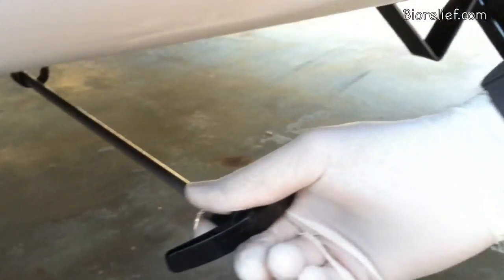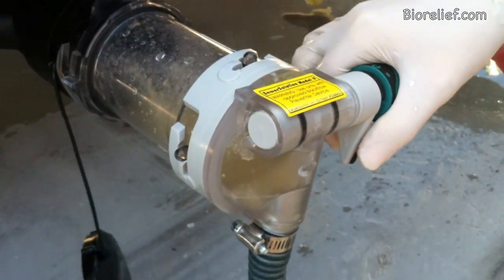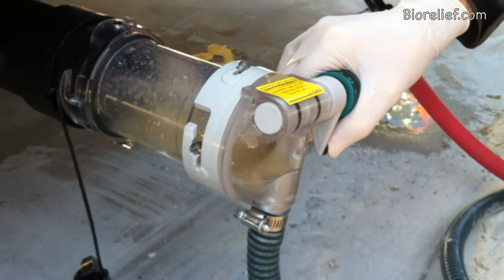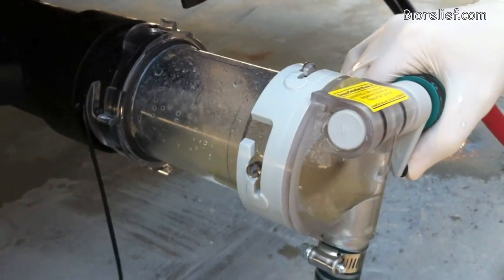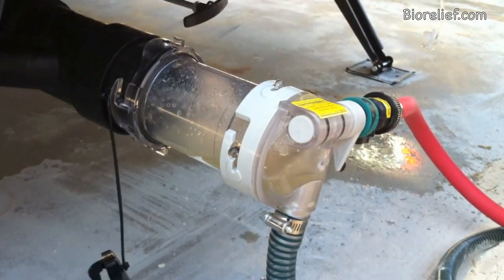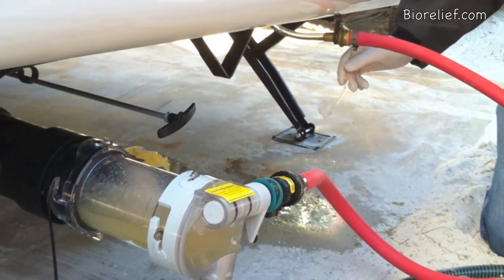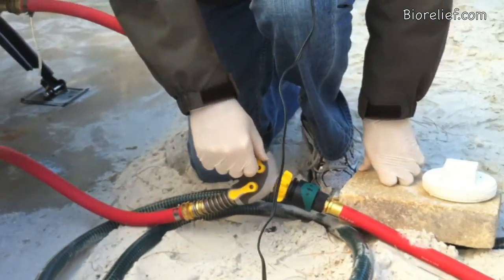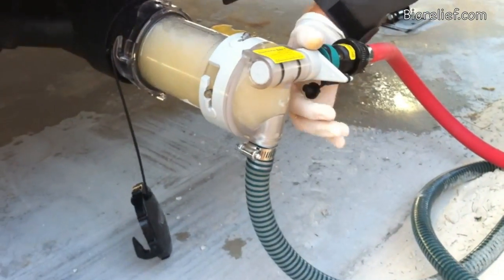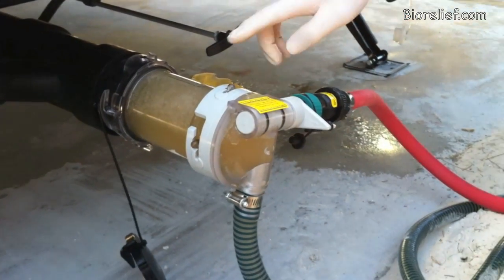Then I'm going to go ahead and close the black water tank — that's closed. Now I'm going to redirect the Sewer Solution back up the pipe. So now I'm redirecting it back up the pipe to clean out our sewer pipe, and you can see it's still running a little bit dirty in there. We're adding a lot of water here. Now I'm going to open up the black water again, because that'll add all that water that came out of our toilet and out of our black tank. Now I'll go ahead and shut down the black tank. This is all optional — our tanks are already cleared out. Going to get a little bit of pressure going down this hose to help it out, and now it's cleaning out again.